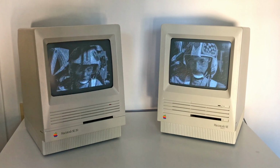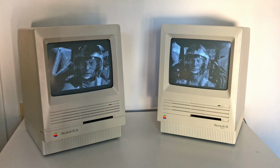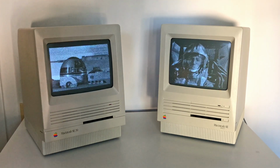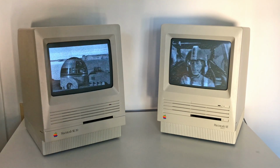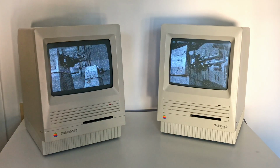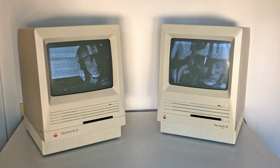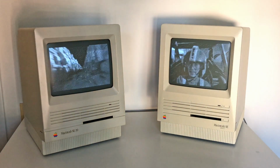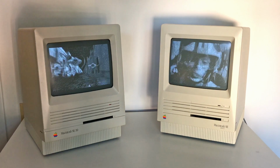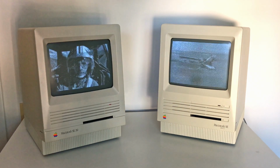I guess the speed differences between the physical hard drive and the SD cards were expected, and also that the newer SD cards are much faster than the older ones. The surprising thing was the random write tests that actually were faster on the physical SCSI hard drive than on the old SD card. It does feel neat to have the BlueSCSI in a proper bracket. This machine is taking shape now. Maybe I'll try to retro-bright it even in the future.